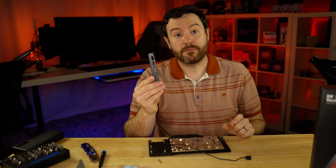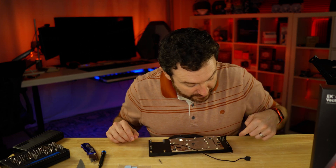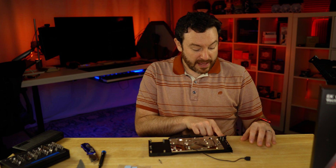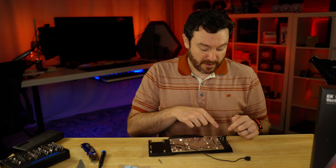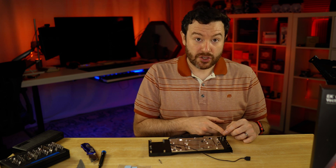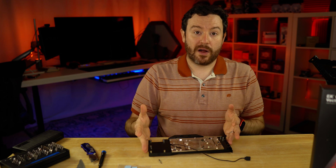You can use the bracket to mock up placement — put it basically where it would sit on the card, and if everything is aligned it sits pretty flush. Take the measurement from the edge of your existing PCIe spacers to the outer edge of your case to know the exact distance you have to work with. If it's 25 millimeters or more, you will be able to fit one of these in there.